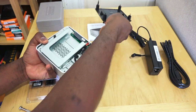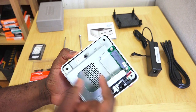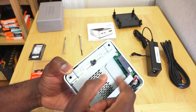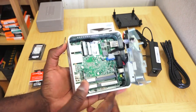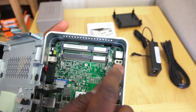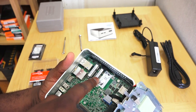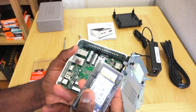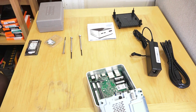What you're seeing there is the drive bay that lets you slide in a hard drive. I'll add a second hard drive later, which is why you can't see it in this video. Flip the bottom panel around and it reveals the RAM slots — make sure your RAM is 1.35 volts. You've also got two PCIe slots: the bottom slot is for the Wi-Fi module and the top slot is where the mSATA goes.